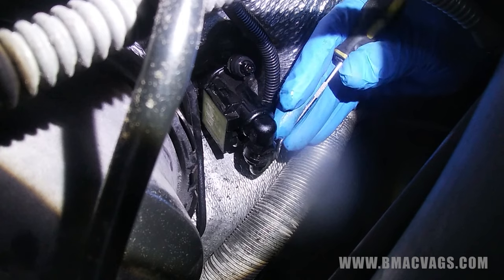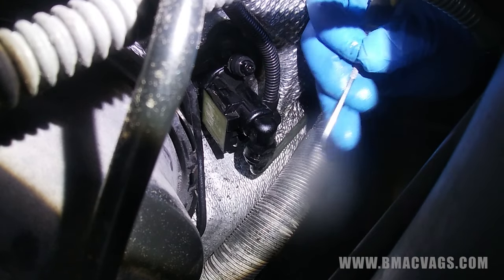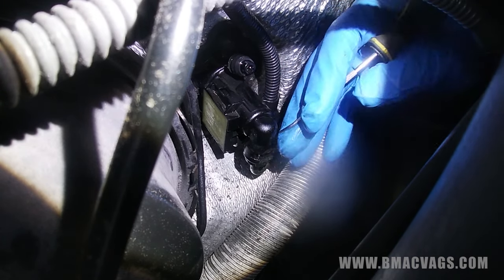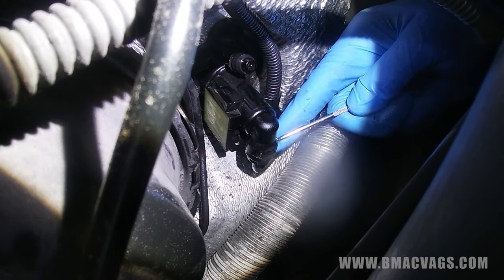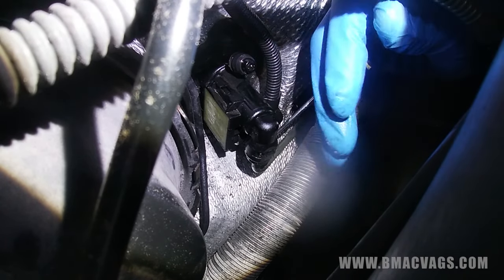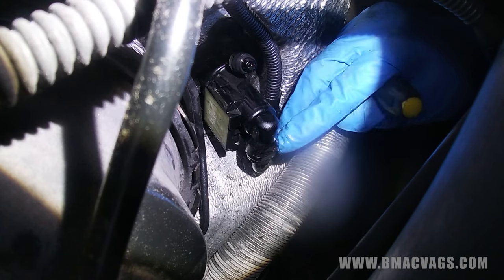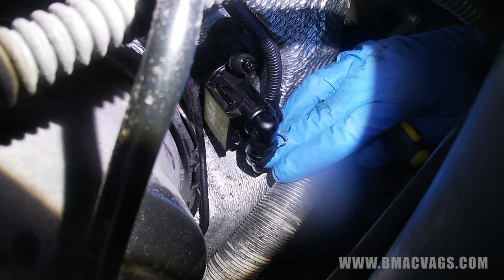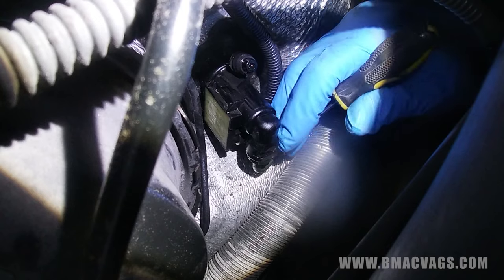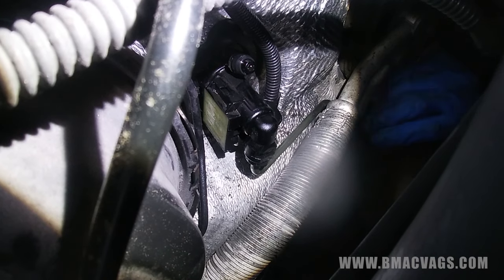Now I'm trying to remove the hydraulic hose at the bottom which goes to the clutch itself. I'm feeling for this blind because I can't see it - visuals are terrible. I'm feeling for the split-pin clip that holds in the clutch pipe. I can feel there's a gap and I'm going to slide my pick in between the gap and the pin to pop it out. Once loosened, I worked my way around, took the pipe out, shook it down - that proved to be the easier removal method.